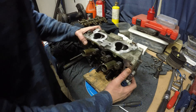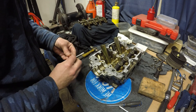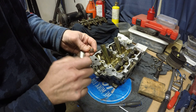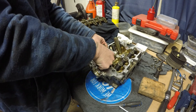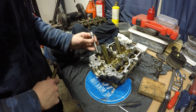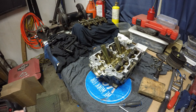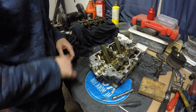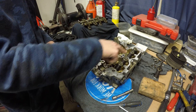All the valves are cleaned up and all but one are installed. I left out one valve seal so you can get an idea of how they're put in. A 10 mm socket goes right over top of the seal, protecting the actual seal and the spring inside, allowing you to hit down on the metal casing. Usually you can just push these on with your finger to start, and once it's on there, just use some light tapping with the hammer — using the socket end, not the extension end. Then get eye level just to make sure it's on perfectly straight. Take just the tiniest dab of grease on the seal; oil on the valve stems is fine too.